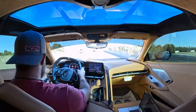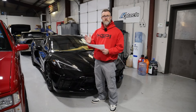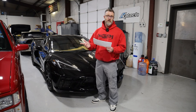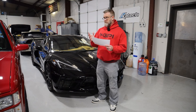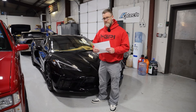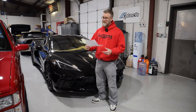I've done a lot of driving and testing on the car and I don't have any complaints. Didn't really know what to expect with drivability on the dual clutch setup, but it's smooth on initial takeoff, drives smooth, shifts great — just like factory. There's no cam surge or cam buck at low RPM cruising, so no negative things to mention with drivability. Tuning aspect — it being a new platform, people not knowing what to expect, myself included — it wasn't bad in my opinion. Some changes from previous Gen 5 LT tuning platforms, with the neural network airflow model being one of them. HP Tuners worked well for us for everything we needed to do. Now I just need to unlock the TCM so we can crank the RPM up and get more aggressive with the combination.